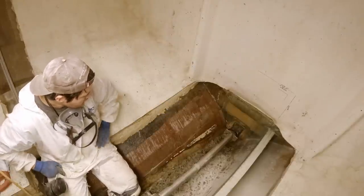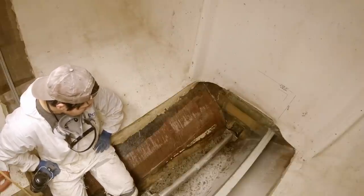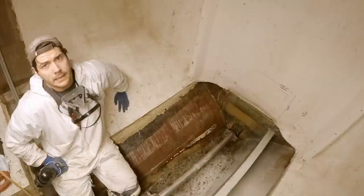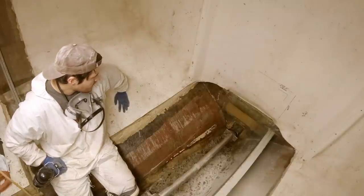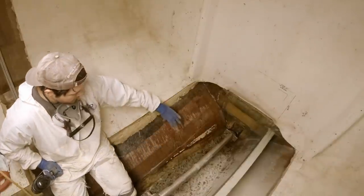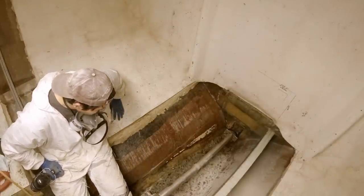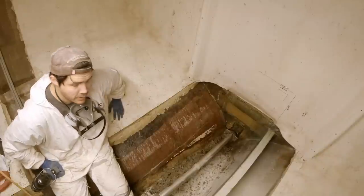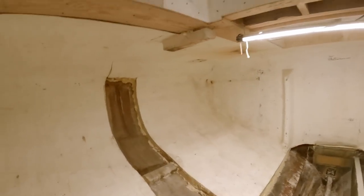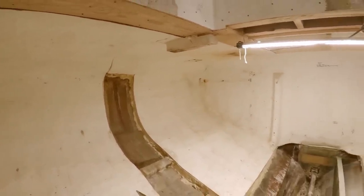Well, not done, come down with a grinder next and prep the surface that way. And just get rid of any leftover flappy fiberglass that's still there from the tabbing. And I think there's some resin right there from where the stringer was sitting on top of it. So clean that off there. And yeah, should be good. Good and prepped. I think we'll probably start on this next. Just keep going on the demo here, so that's where we're at.